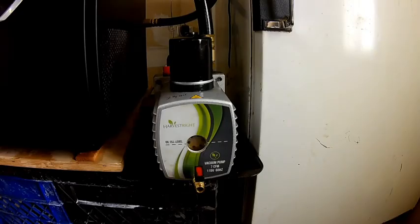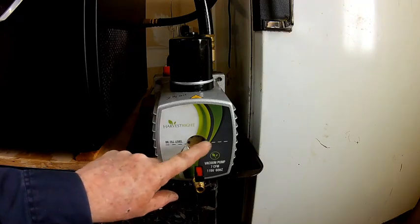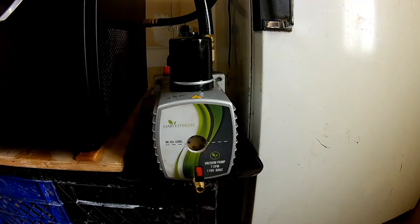I'm having some problems with my vacuum pump. It won't draw anything lower than 1650 millitorr. I think the vanes inside are worn. This will also give me a good chance to clean the little sight glass here, which is pretty simple to do.